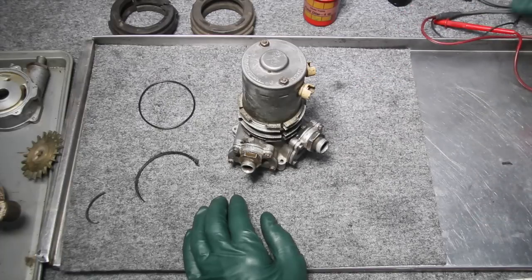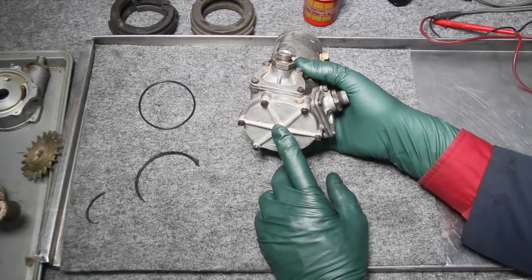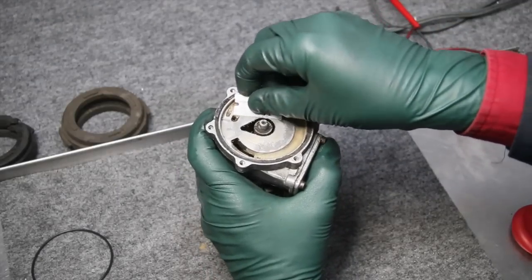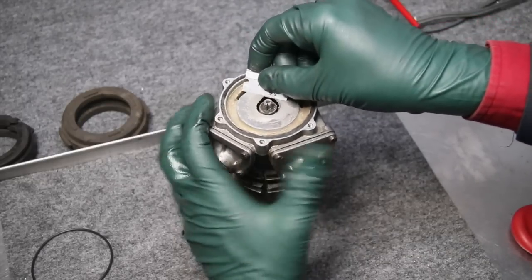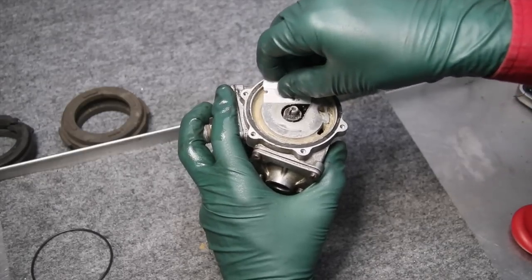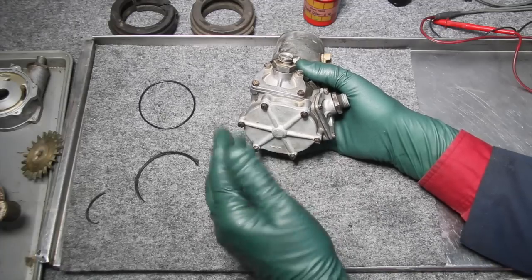It wasn't as easy putting it all back together or even cleaning it up. I had some real problems getting these parts cleaned. I tried as much as I could with a plastic scraper and I ended up having to use a single edge razor blade. You have to use a brand new one and be very careful — get a lot of angle to it and don't push very hard because you don't want to scratch the aluminum. I had to work that crud off with the razor blade; it was the only way I could get it off. I didn't want to take a wire brush or sandpaper to it, but in the end it worked quite well. Always lubricate the impeller — always lubricate that impeller up with oil.